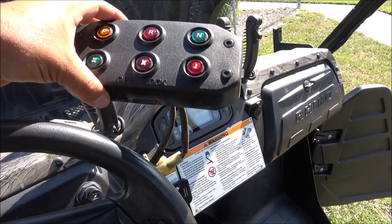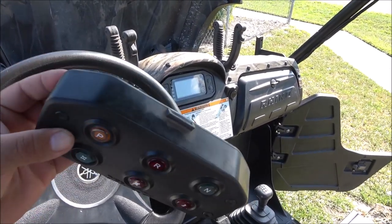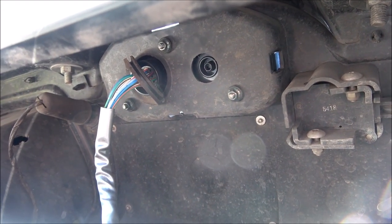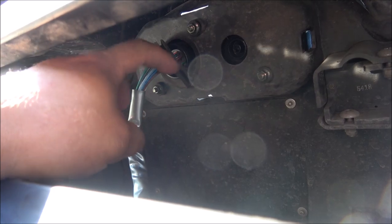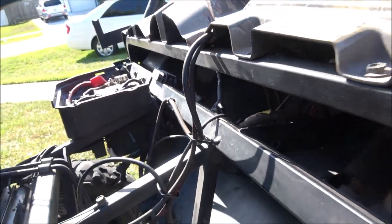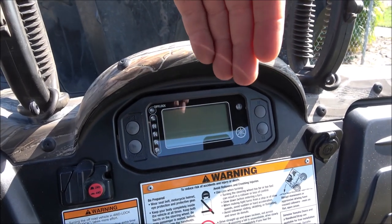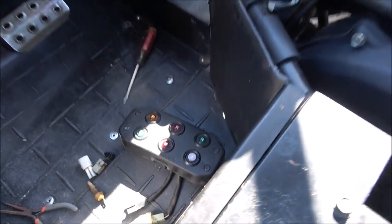The first thing is that when you get this and remove the old one, it is held by a few clips from the side and the top. All you have to do is open your hood and you have access to it from the very back. Push it in from the very top and also from the sides — make sure you push in the clips and it'll come out. Then with your hands or a pry opening tool, you pull it towards you and it comes right out. There are no screws that need to be removed for this stock one.